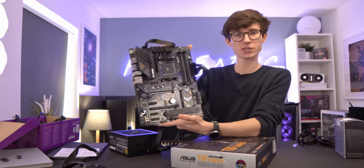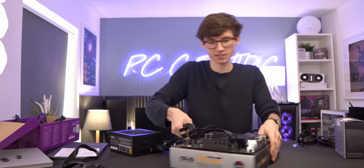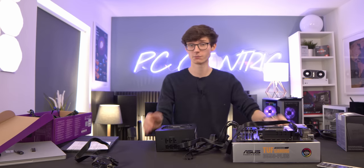Your motherboard should resemble something like this. Do not touch your motherboard once you've actually connected your power supply to the mains, for obvious reasons. Best case scenario, you hurt your hardware. Worst case, you hurt yourself. Make sure your power supply is actually turned off until you're going to need to flash the BIOS.